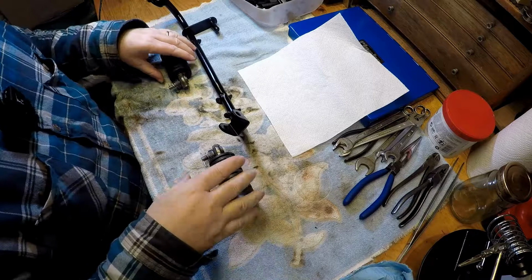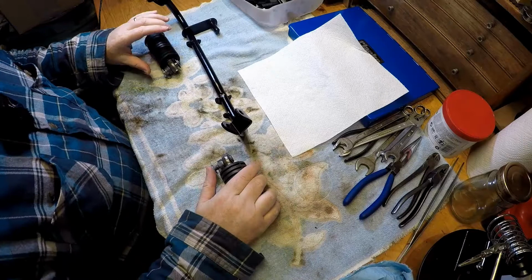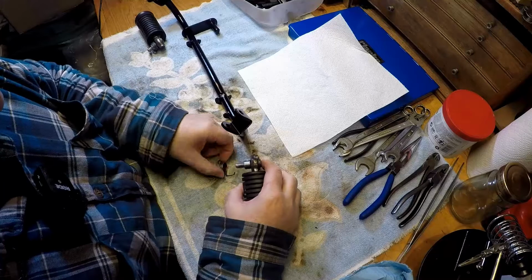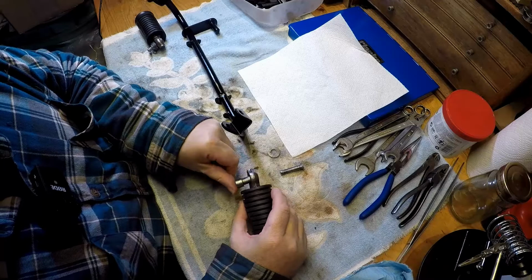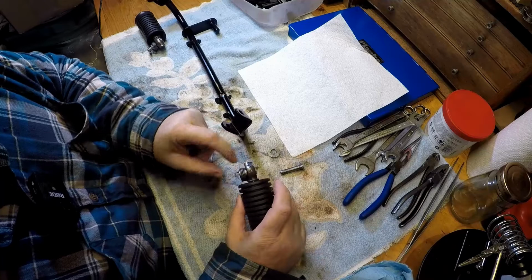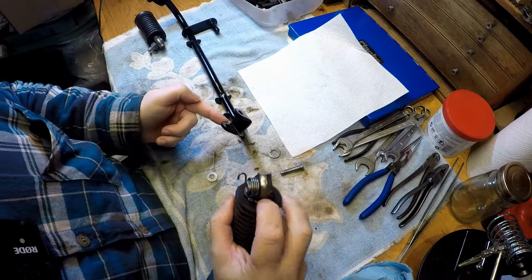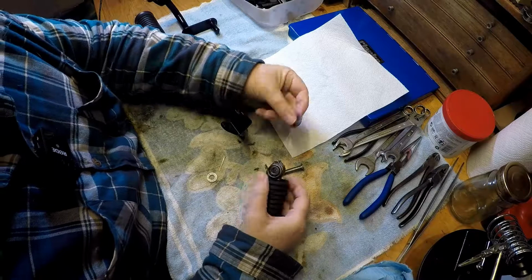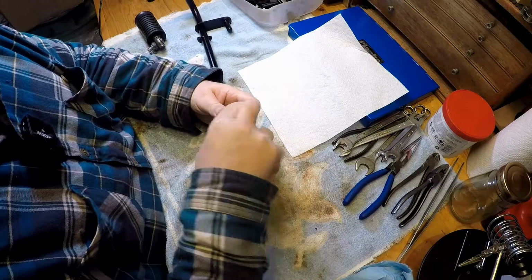They are left and right-handed, and so that's the front of the bike that way. So this is the right and this is the left. The main parts for this are the collar, which fits into there. Then we have the spring, which sits on with its square hook over the foot peg, so that this engages with the side here of the pin. Big washer goes over the top there. And this all then slides into there with the pin going from the front to there.